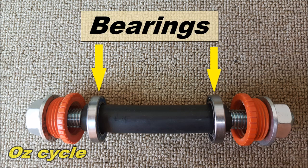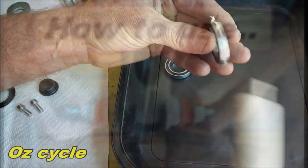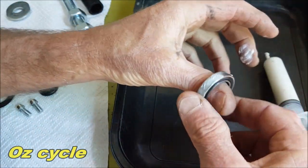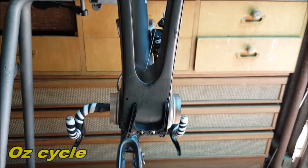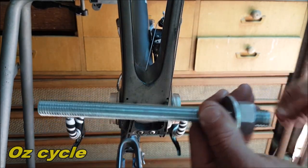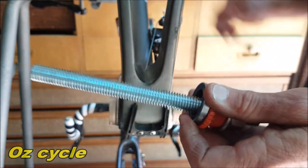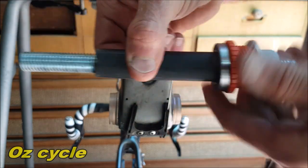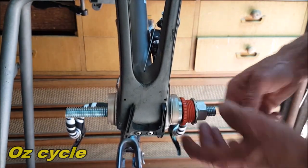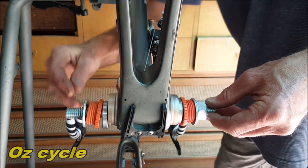When using the tool, make sure your bearings sit on the piece of poly — it's a guide to keep them central in your bottom bracket shell. Remember that your bearings do need lubricating before you press them in. So, here's our bottom bracket, and now your piece of thread with one nut and one washer, and then the tap piece on like that with the flange facing inwards, onto the bearing, and then your piece of poly — that goes inside the bearing like that. Now just put it into your bottom bracket shell. It can just sit there loosely, and your bearing on the other side with the tap piece, flange facing inwards, washer, and the nut.